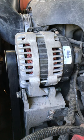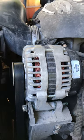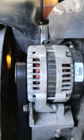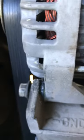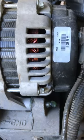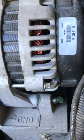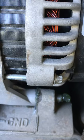After some research, I found that grounding the alternator was the problem. I removed the alternator and cleaned the spots where it bolts in. You can't see the other side because it's underneath the vortex cover, but I cleaned them and applied Deox — that green stuff you see — on installation.